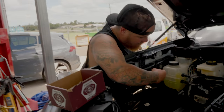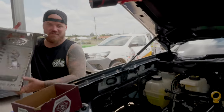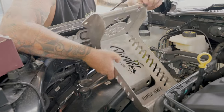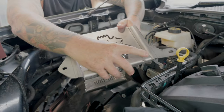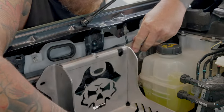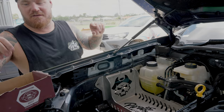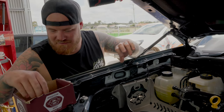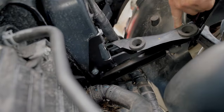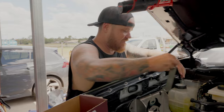Once that's in, we've got the little M6 bolt we started earlier. Sit the battery tray over - get our battery tray - and slide it in. This slot at the back sits over that bolt and helps you line it up. Gets everything somewhat lined up. Now this is the important part: do everything slow. You don't want to go crazy and start tightening. Get everything in and sitting nice before you tighten - the bracket bolts one, two, three around here and this one here are all tight and rock solid. Then we're putting the tray on and lining everything up.